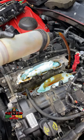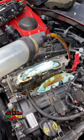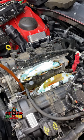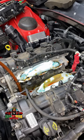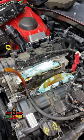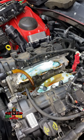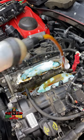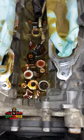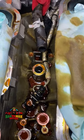If you want to reuse the coolant, just clean out the container you're draining it in — you can reuse it, don't worry about that. Drain it down first and then remove the housing so the coolant doesn't keep popping up. The guys who work at Chrysler knew this — I don't work on these all the time, so I'm noting this step. Long story short, I'm just cleaning all of this fluid mess out and then I'll proceed with the repair. You can see the coolant level right at the top there.